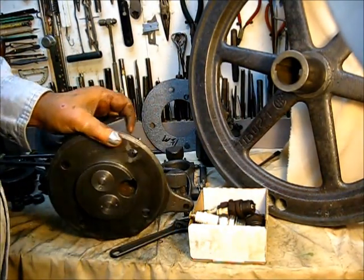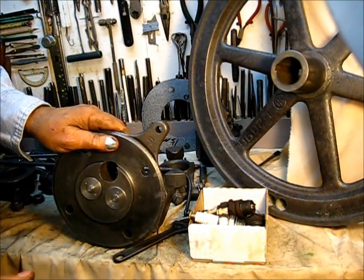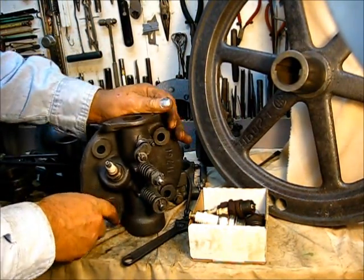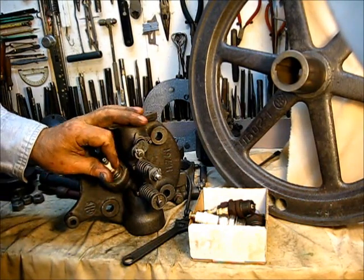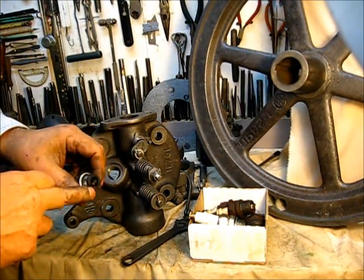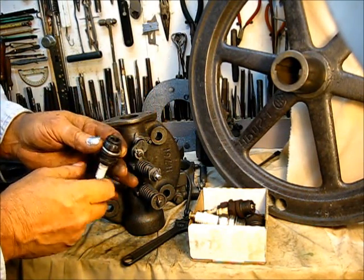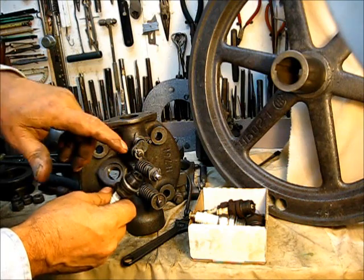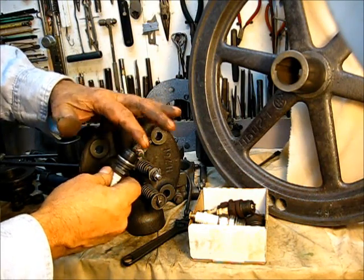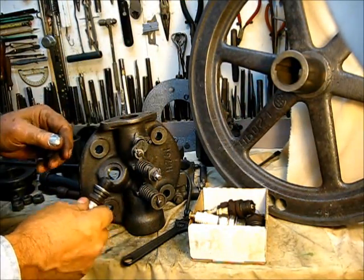More important than the plug itself is the index — the index of that plug when you look up into that hole. The position that plug ends up in is more important than anything else about the plug. The heat range is pretty important too, but you see where that little finger comes over? There is actually a dead place on that plug right there. If this end is facing the open chamber, the spark has to come around it; if it's like this, it hits it head on.